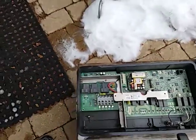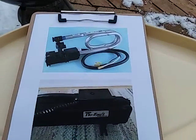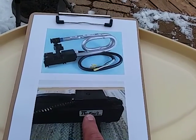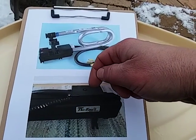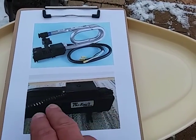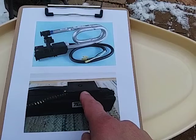If you have a much older spa, you might have an old heater style — a big black extruded aluminum block heater. It had a reset button on top of the box underneath a piece of tape. You'd take a ballpoint pen, poke through the tape, and hit that heater reset button, which may have popped if the heater overheated due to a dirty filter or an airlocked circ pump. Hitting reset would get it going again.